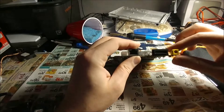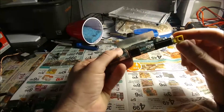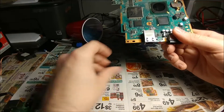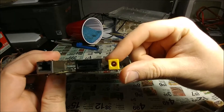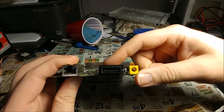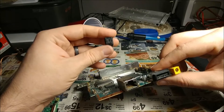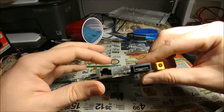For IO, I'm going to use the existing barrel jack. I'm in the process of desoldering the barrel jack and this multi-AV component out. I already took the digital audio out, and I'm going to use the ethernet. I'm going to gut the multi-AV port and put an HDMI port in there. For the digital audio port, I'm going to gut it as well and put a 4-pin 3.5mm jack for composite video. And then obviously there'll be ethernet.